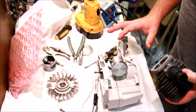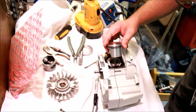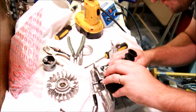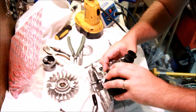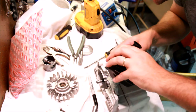I'm not going to use any sealer on this base gasket, I'm going to leave it as is. They're single use base gaskets, so I get one shot at this. Also, a little bit of blue Loctite on the threads. Make sure your circlips are in — which they are. Getting the rings in is not super easy if you're doing it by hand, and what makes this harder is that I took most of the bevel off the cylinder itself — that helps the rings kind of slip in. I usually get one side down. You can use ring compressors here too.